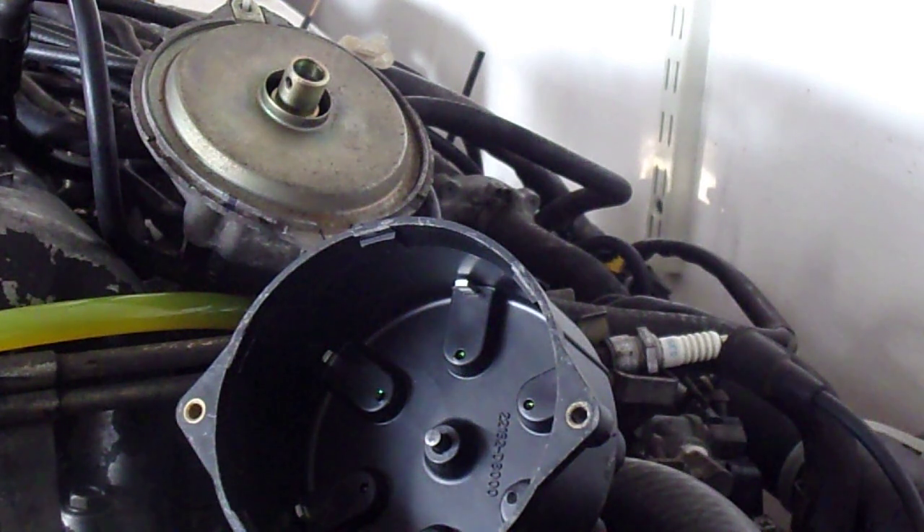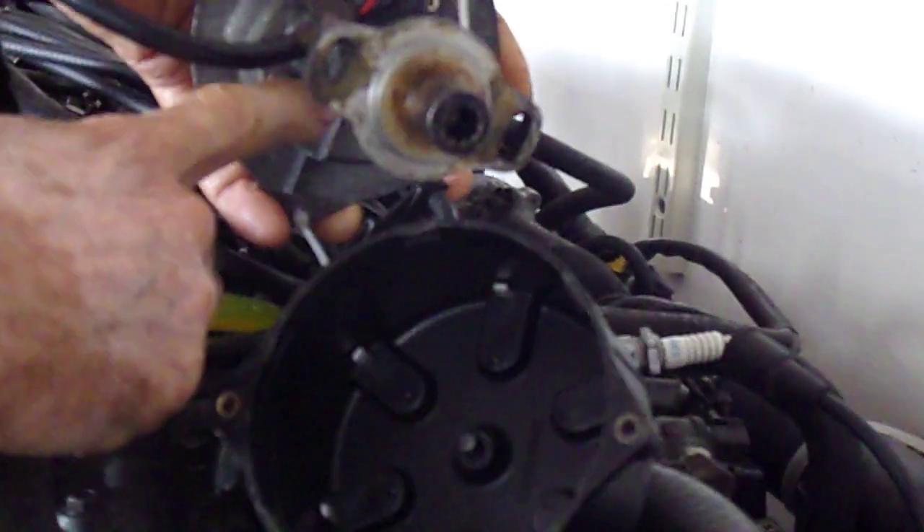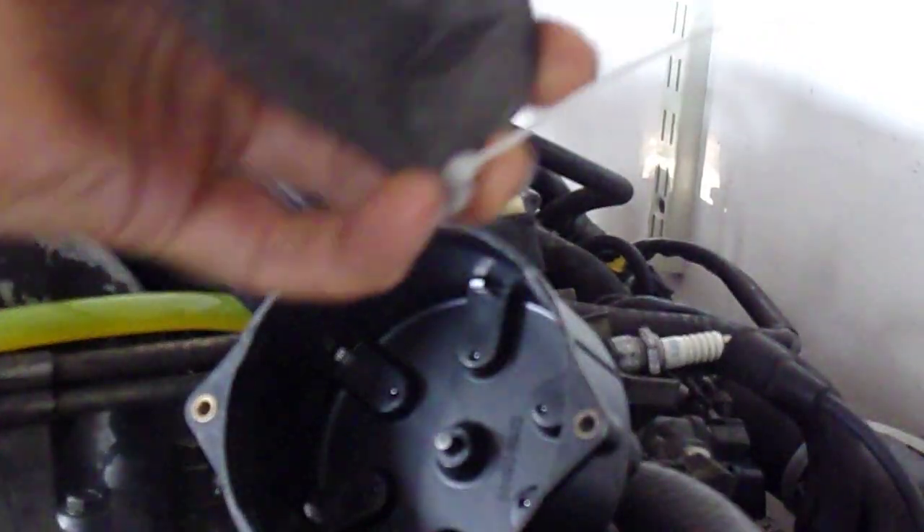I'm thinking maybe there's a piece of debris covering one of the diodes. There are two LEDs shooting through to that little module on the crank angle sensor. At one point this thing was not secured well - these three screws here that hold this together were simply missing, so the board inside was not securely attached and that wheel was possibly crashing into it. I'm curious if there's any damage done to that little module that shoots the light through the chopper wheel.